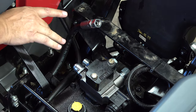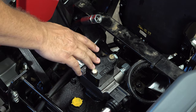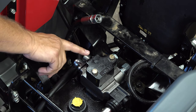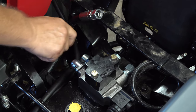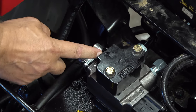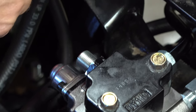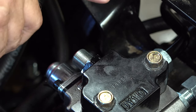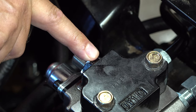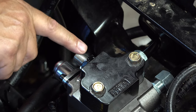You're looking at the hose I disconnected. This line came from the loader valve and went up to the rear remote valve on top of the rear of the transmission. This is where I'm breaking in to my hydraulics. For those doing the T25 or the T264, this is what we call a British thread. When you go to your hydraulic shop, just bring that adapter out of the valve and carry it with you — that makes it easier for them to match up the hoses.